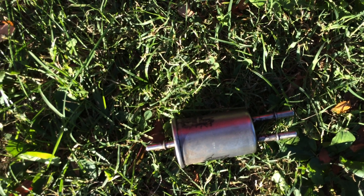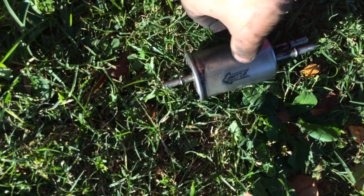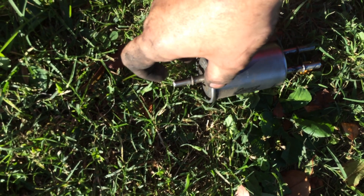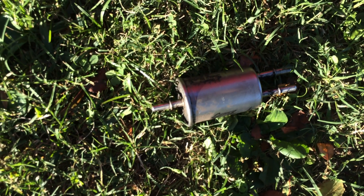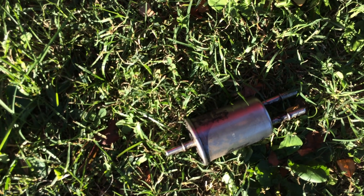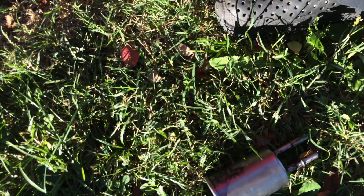If you don't hear them click, they're not on all the way. Also your flow on this one is self-explanatory because you've got one line right here that goes to your fuel from your tank to your injectors. This one's got a hairpin clip on it, kind of like all the other older Fords did. Your fuel filter may or may not come with only one of those clips — don't freak out, it's that way for a reason.